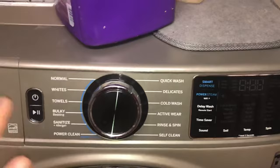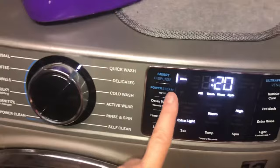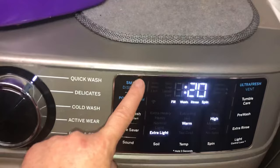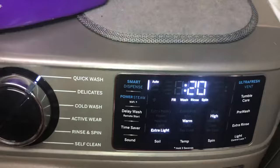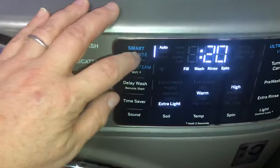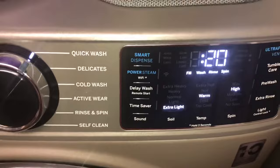Once you've filled it, how do you actually get it to dispense? Turn on the power button here on the left. You'll see right here where it says smart dispense — you push on this button here, it's not really going to click. It'll rotate between auto, none, less, more, and auto. So it goes through those different options. If you're adding a powder detergent or your own detergent each time you do laundry, you're going to use the front section of the drawer and have the smart dispense set to nothing selected.